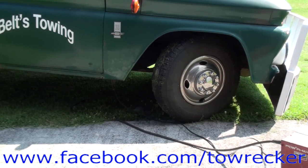Be very careful with your MIG welder when you're welding on the metal of a vehicle like that, because you can blow through the metal real easy. You want to use your low power setting, and your best bet is to take an old fender, cut a hole in it, and try to weld a patch in it before you ever try it on a car. I was welding on high under there just because of the rust. I couldn't get a grinder in there to clean it up, so I was welding rusty metal. And there's two things about rusty metal: it takes a lot of heat to weld it, and it doesn't make a good weld. So you can blow through. But I was in a situation where if I did, I'd just take another piece of metal, make another strap, and try again.